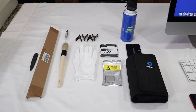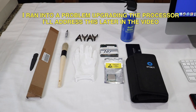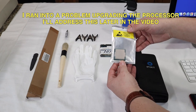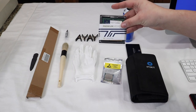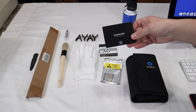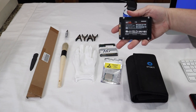But before we begin, I want to go over all the parts you'll need if you want to do this upgrade on your own iMac. I'll include links to everything in the description below. I'm going to be maxing out this iMac, so you'll need a fourth generation Intel i7 model 4770S processor. I got mine on eBay for around $50. You'll also need two 8 gigabyte DDR3 RAM sticks and a 1 terabyte SSD. I personally prefer Samsung Evo SSDs because I've never had any one of them fail on me.